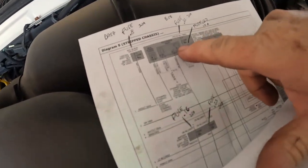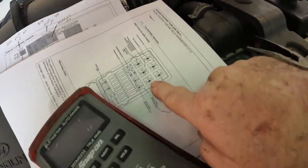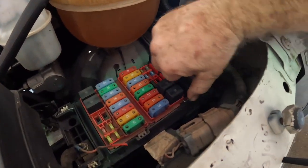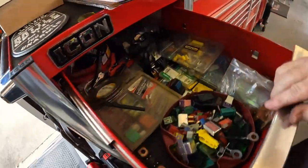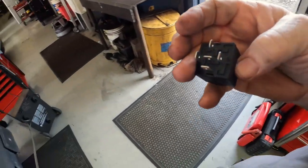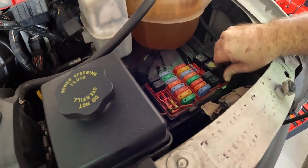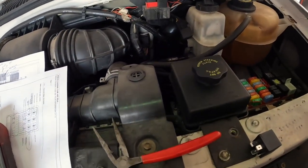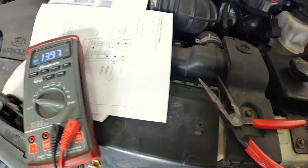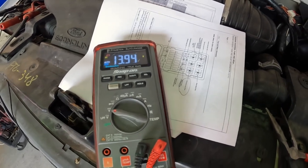I think what's happening on this Ford is the relay has a bad contact, because this is the fuse that's dropping voltage, and the voltage on all the other fuses going in are good. So I'm going to find the PCM power relay, which according to this is the second relay right over here. Looks like someone may have been in here playing with it — it's a little bit hot. See if I can find a test relay in the old toolbox. Looks fairly new. I'll show you what the voltage is with this relay in here. I just heard a click — all kinds of stuff gets happy. Let's see what the voltage is on the output fuse to the PCM. Now it's showing good. So now it's going to run. Disturbing that relay probably fixed it.